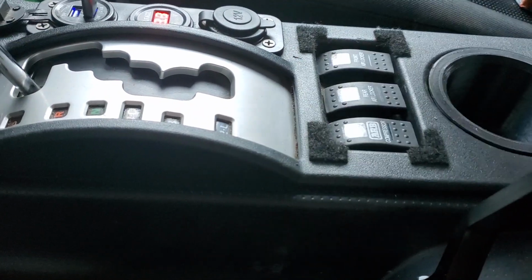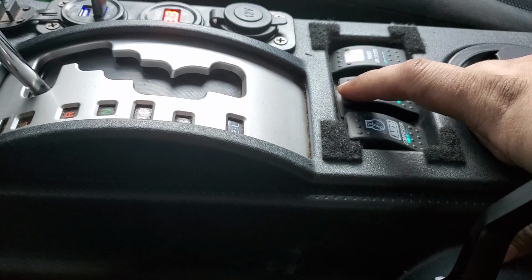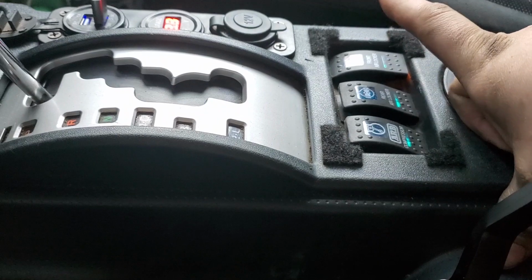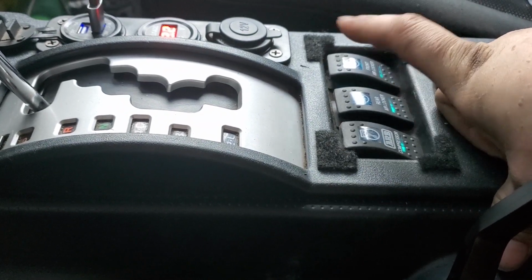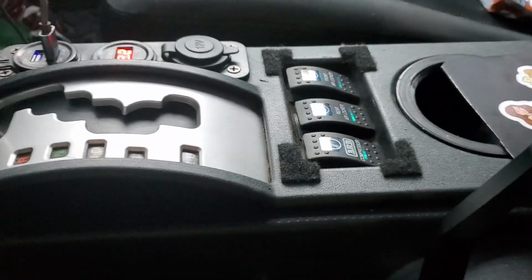So basically, we're gonna start at the front, work our way to the back. That's my face, not the back. The back. And I basically start at the frame and work my way out. One of the other things that I do is hit the compressor and then unlock the locker and listen for the psh. I do this until it pressurizes, and then keep these pressurized while I'm bolt checking, just to see if there's any weird leaks or anything.